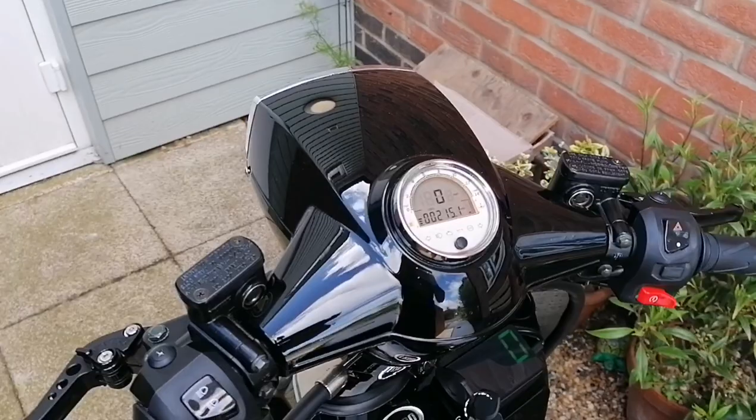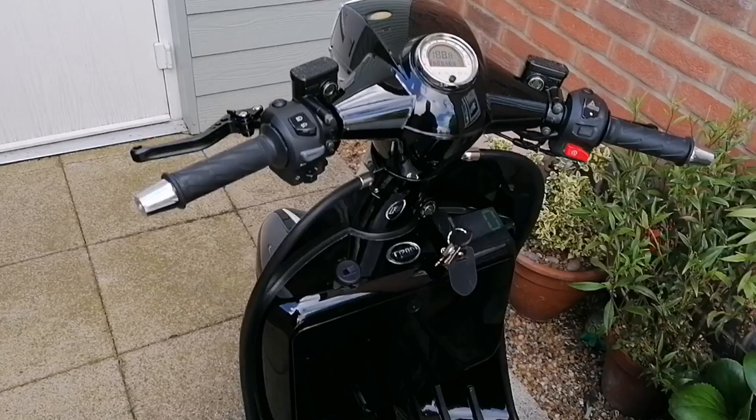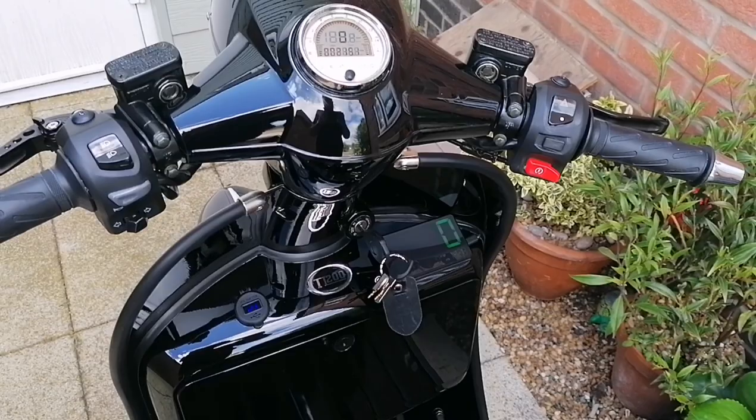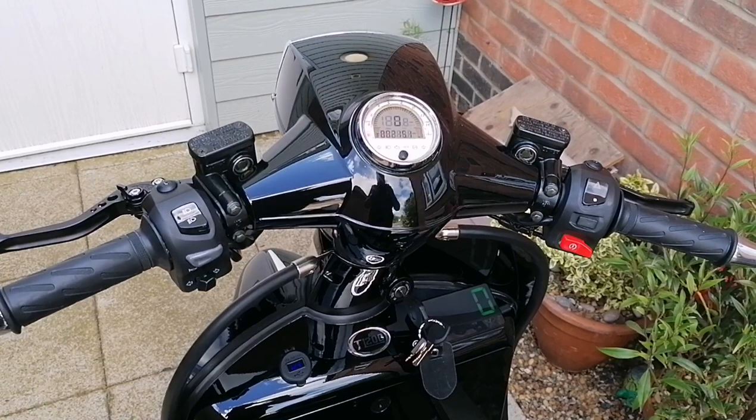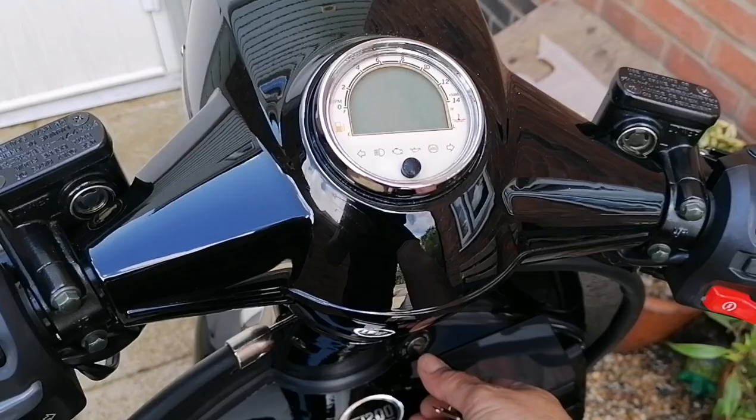It's the second one I've had. But I've got the sat-nav on it now — a nice little speedo wired in, really easy to wire in. I took it its own designated earth from the battery tray and wired it through the tunnel; they're really easy. Paul told me that the black wire in the headset top is a switched live, so when you turn it all off, it's dead.